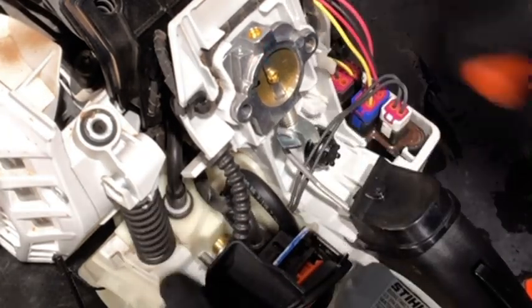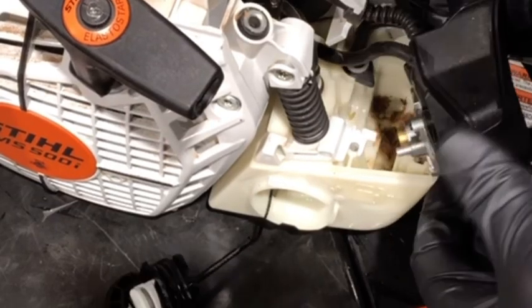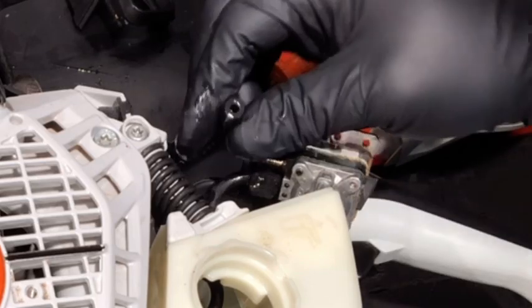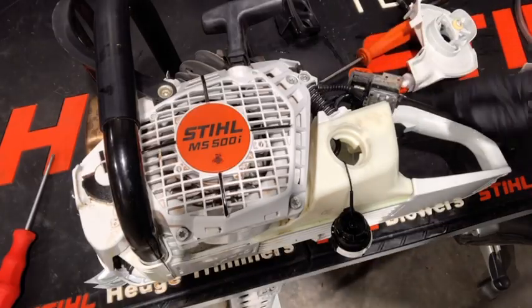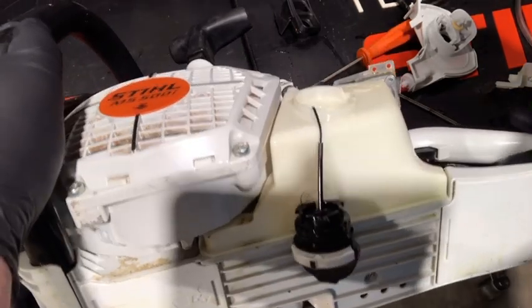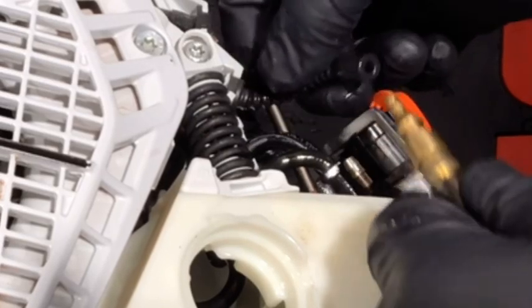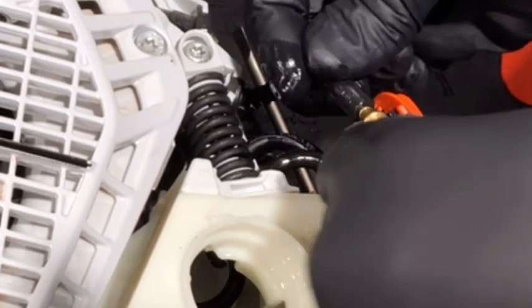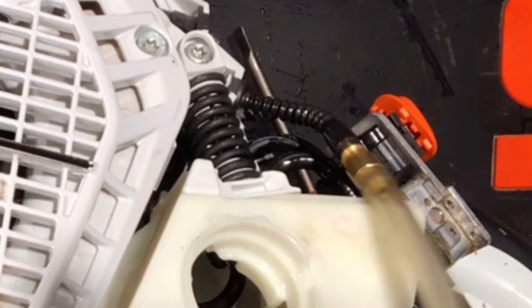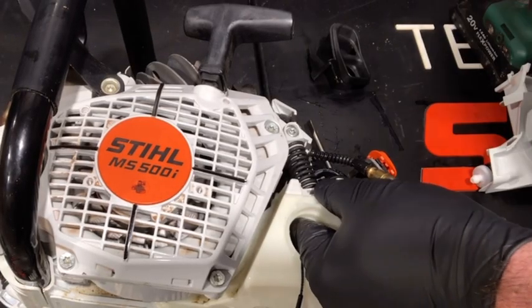Next I'm checking the injection hose. To do this you're going to remove the injection hose from the fuel injector and repeat the same process with the pressure vacuum test. You need to plug or seal the return hoses inside the fuel tank when you're doing this test. If you look inside the tank it's going to be the black nipple that's on the top side of the tank right below the AV spring. Hold pressure to this area while you're doing the test to make a tight seal.